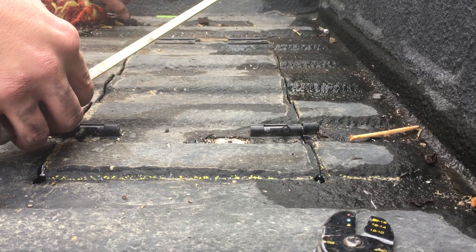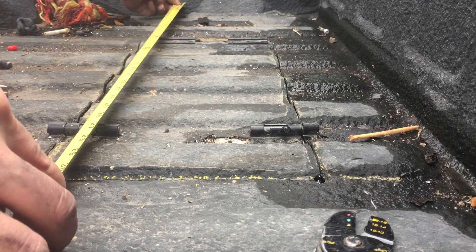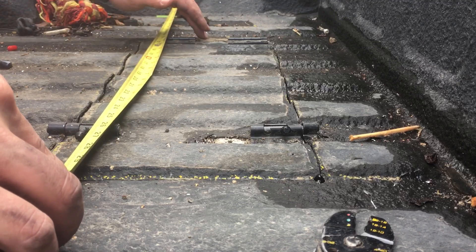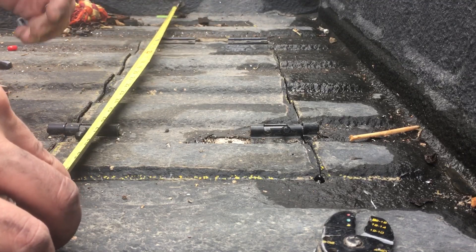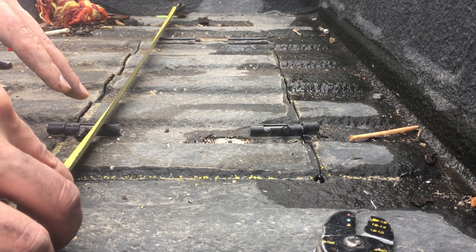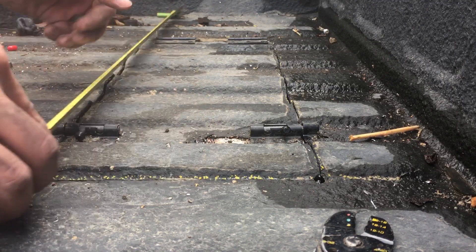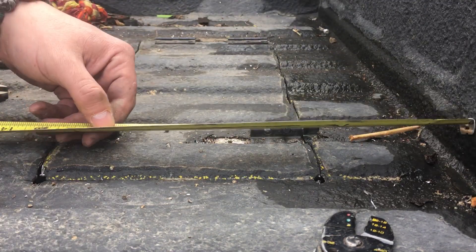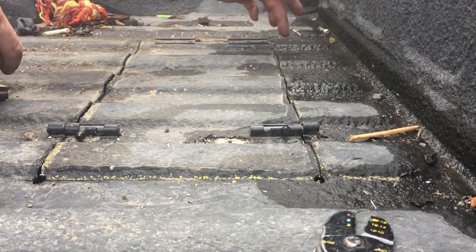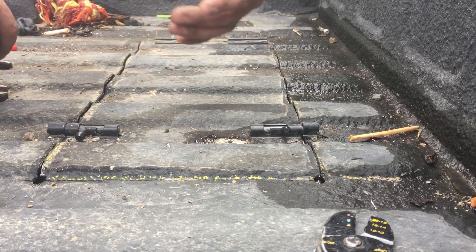I'll give you some measurements. It'll go from the driver's side wall all the way over. I went to twenty-nine and a half to this line, eleven to the other line. Make sure you keep your blade nice and flat because if you don't know what's under there it gets a little scary cutting near wires and hoses. I went four and a half to about thirteen. I drilled four holes, making sure I didn't over-penetrate, since I didn't know what was down there the first time.